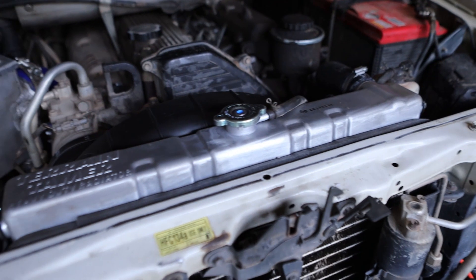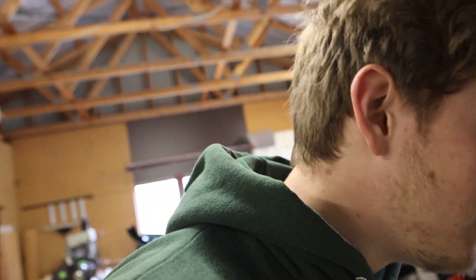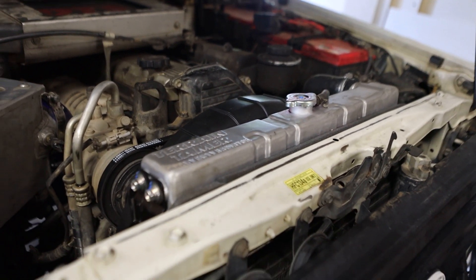We're all back together — everything's looking good. Just got to put some coolant in, then turn it on and let the coolant flow through. I filled it all up with coolant and ran it for ages but couldn't get the thing to temp, so I had to take it for a drive. When it was just idling, all topped up, it was sitting at around 76 degrees — the thermostat's not even open at that. So I took it for a drive to make sure everything was working properly. It's all working fine, no leaks, nothing overheating, which is good. The real test is going to be when summer comes around and you hit up the high country. Physically it feels like that fan pushes more air, but that could just be a placebo.